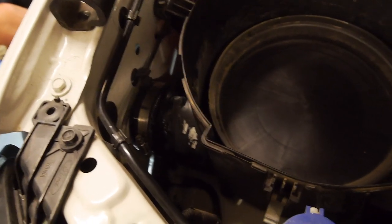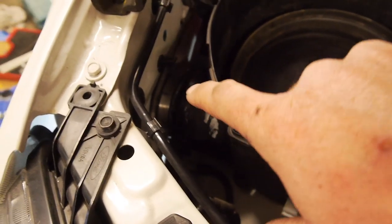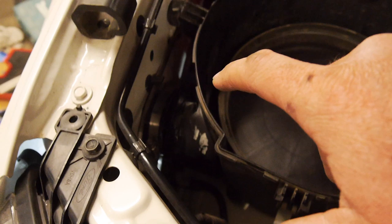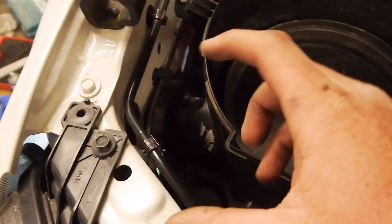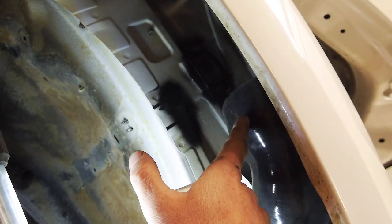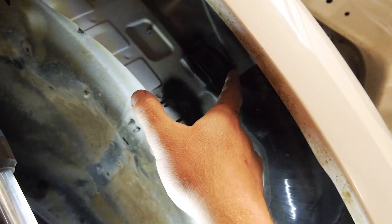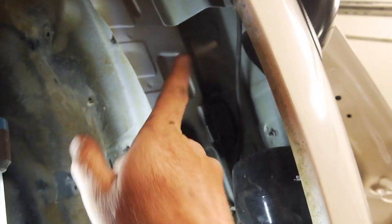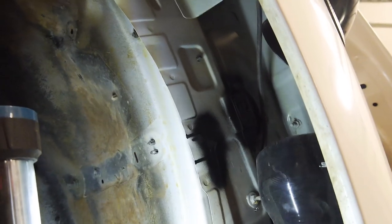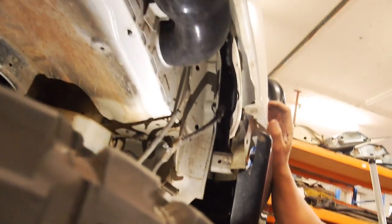So we've got the 4-inch to 3-inch coupler in. We had to basically put the clamp on the airbox first, slip the coupler on, and then with another pair of hands, finagle it back into place. Then the only thing that's left to do is put the 4-inch piece of tube supplied in the end here, clamp that on, and also put the accordion hose from the snorkel down to the silicon elbow. And just like that, it is done.